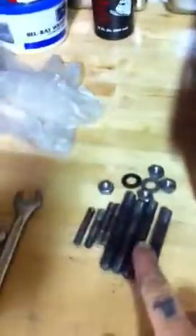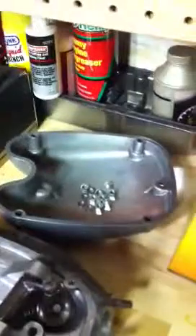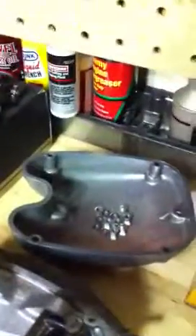So this gasket is going to go in here and I need to put all the mounting hardware — I'm going to buy all new stuff, this is the old stuff. Same with the rocker shaft — you can only install the intake rocker first, which I already have, because you need to leave the exhaust off. There's a hole down there and you can't get to tighten down the head. After cleaning the new head with acetone, the rocker box looks great with all new hardware. These little screws go in and the old ones screw into the head — I'm going to buy all new.